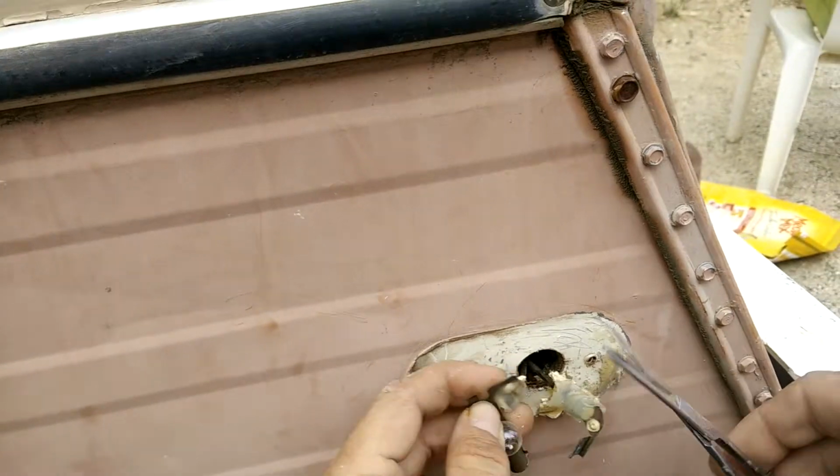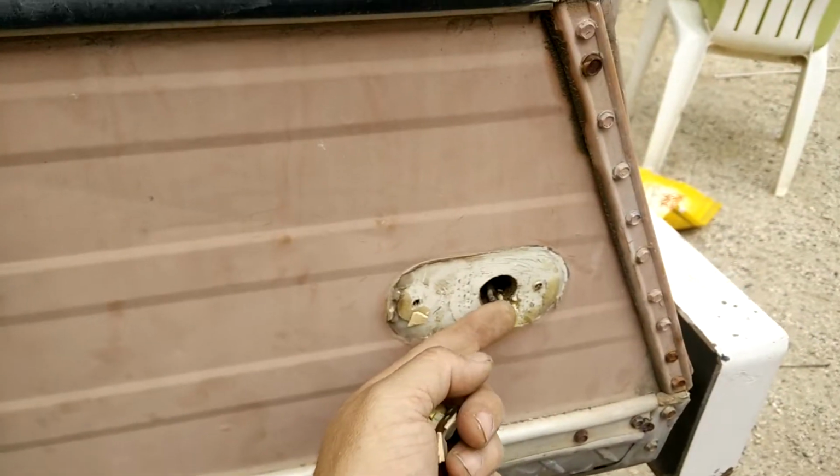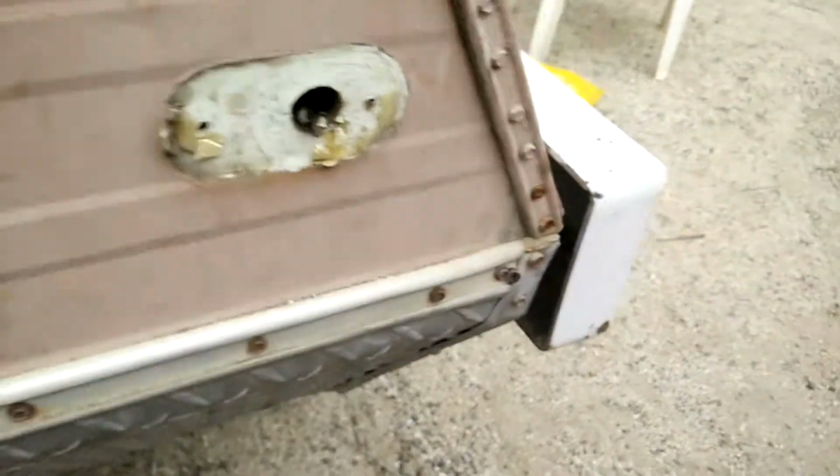And now we're going to get in here and separate these two and cut them. And then as you see, there's like no wire sticking out. We'll deal with that in a second. These wires right in front of us here are the other side of the wire from that clearance light. We're going to have to unhook it where it's tacked on and pull it down to give us a little bit of slack so that we can pull it through. Then we're going to connect the wires off of the clearance lights into that and push it all back through to this side and then tuck it up nice and neat. But this is just one more little inconvenience. There's always a problem with anything you want to do. Look at them Black Widow webs. I better get my hands out of here, not keep them in here any longer than necessary.